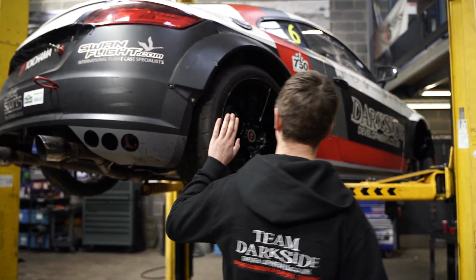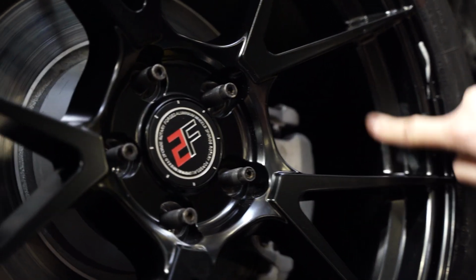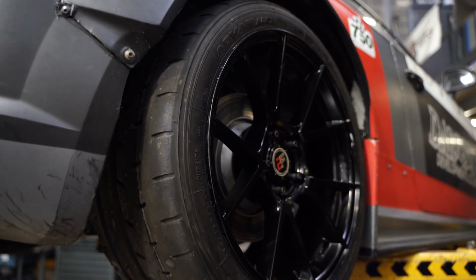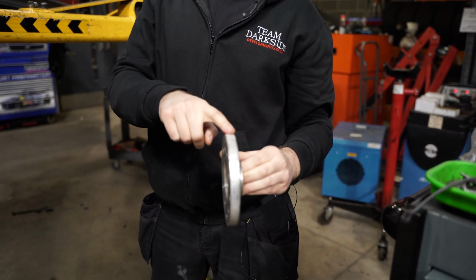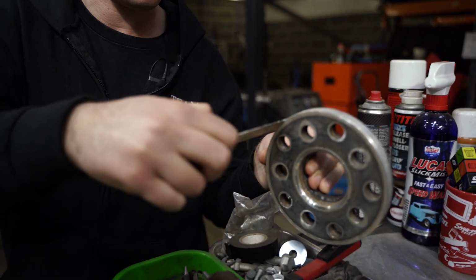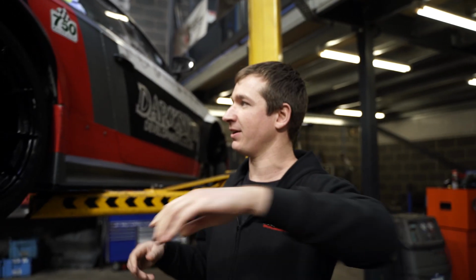But this, you can see here, we've got another 2 forge wheel, which, that's just tyre soap and whatever it is. These are 10-inch wide, and we've got a 265 tyre on there now. So we just literally took the 20mm spacer out, which is here, 15mm or whatever it ended up being. Took that spacer out, which, what is it? Look at that ruler, beautiful. Where are we? Yeah, 15mm spacer. So took the 15mm spacer out.